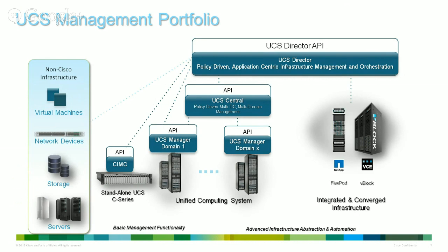And essentially, that's what we do with our servers and the storage connections, the network connections, the whole server personality within UCS. We make that completely defined as part of a service profile, defined in software, instead of being defined by, for instance, UUIDs being burnt into the motherboard, or MAC addresses being burnt into a network card that are fixed.